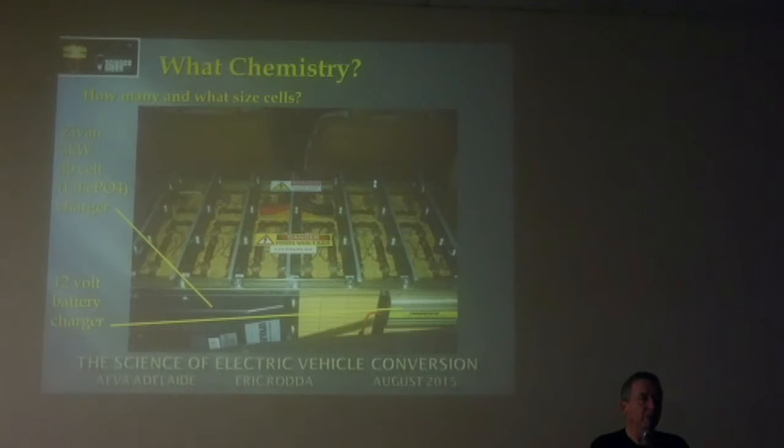Can you bypass that cell still? Not readily, unless you've got spanners and things to actually disconnect it and put a little link from the cells around it. You'd have to have a toolkit and have all that ready to go. What I would do if you're driving and it comes on is pull over, and if it keeps going even when you stop, that's really, really bad. But if you slow down and the alarm goes off, you could continue to drive at a really, really slow speed if you're close to home, and just crawl.